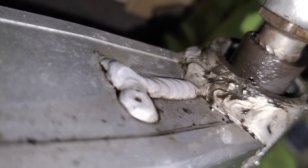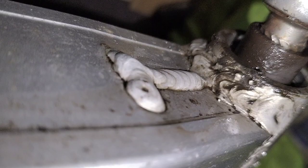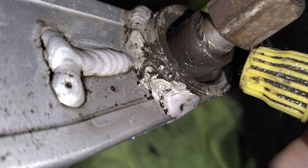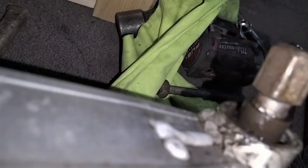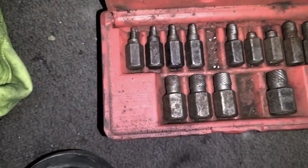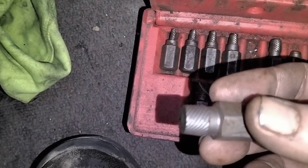I have this in here and as you can see it's starting to wiggle, starting to move. I have both sides of that to do. I've poured in plenty of WD-40 — just pour in plenty of that, let it soak down and soften things up. This is a snap-on kit of stud extractors — they go in the opposite way around if you're drawing out a stud.